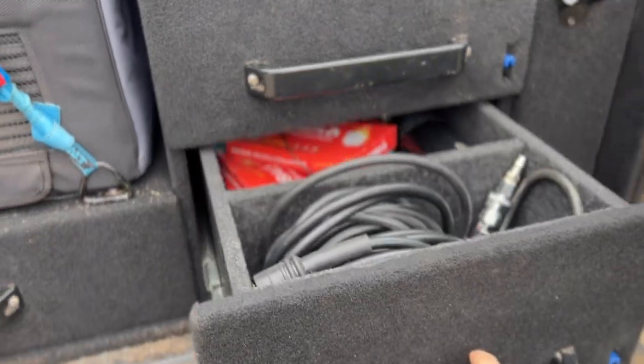I've used 3/8 inch to quarter-inch BSP barbs, which works nicely. Put thread tape on anything you're screwing in. You'll also need the 150 amp relay, the switch, a bit of wiring, and a couple of fuses — pretty straightforward. It's going to make life so much easier. There are lots of times I haven't let my tires down on gravel roads because I couldn't be bothered with the hassle of getting the compressor out. Now I can just turn it on, grab the inflator hose from the drawer, inflate, turn it off, put the hose away and drive off — no waiting for anything to cool down, no packing away. Even a really cheap air compressor works well installed in the car. If you like the video, hit like and subscribe — see you on the next one.